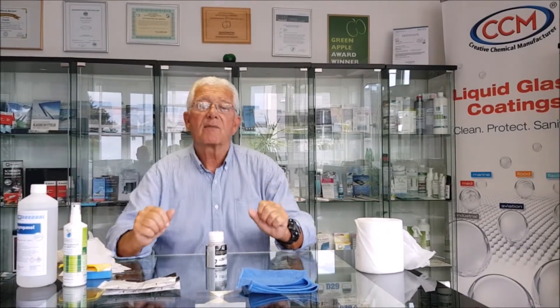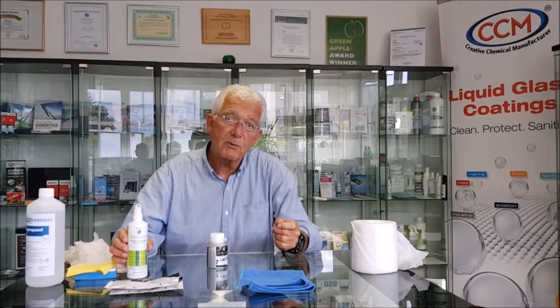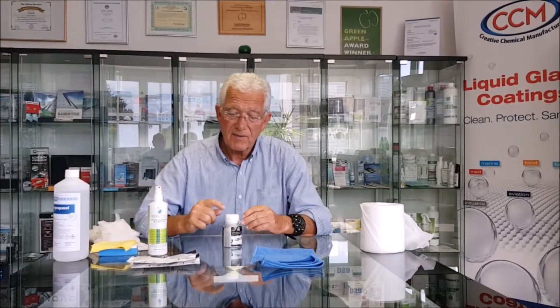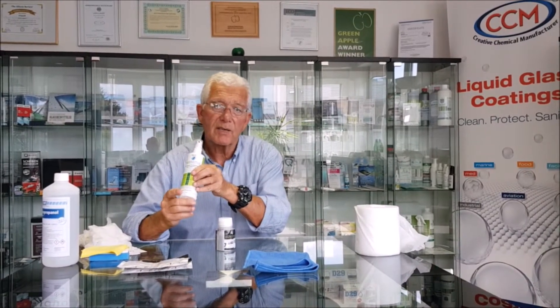So how does this all come together? Well, the first thing we have to do is clean the car. We use the Biosativa mixed to a ratio of about 1 to 15 to get all the heavy soiling off. I stress this is not to remove previous coatings — if there are other coatings in place, you'll need to use either a silicone remover for wax or silicone layers, a clay bar, or specialist cleaning solutions. We're assuming the car either has one of our coatings on or is free from any coatings. So we wash the car down thoroughly, using any cloth or brush you like, then rinse. Biosativa is completely bio-based and won't do any harm to the environment.